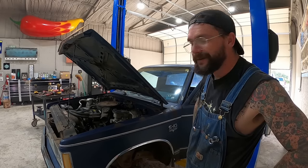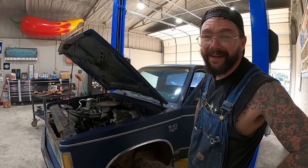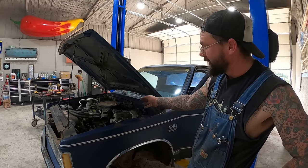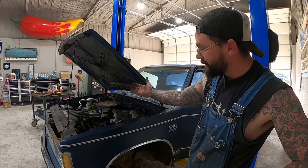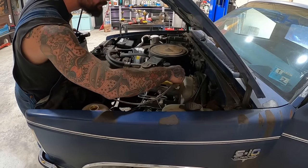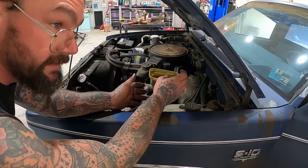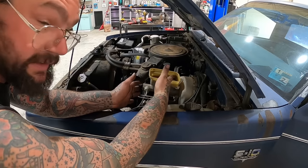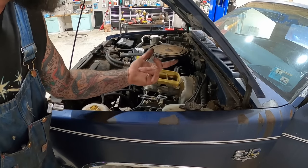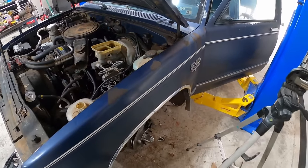The last little bit we need to do for our brakes is, I am gonna go ahead and put a new master cylinder on it, just for the sake of having one with good seals. We really don't know how long this one had been sitting, and I just don't want it to be a future problem for someone else. Now that you've cracked all your brake lines and the fluid has got all over your shop floor, it's a good time to go ahead and suck out the fluid out of the reservoir. As you can see, it is actually pretty dang dirty in there. So putting on a new line and giving this system a flushing definitely is not going to hurt nothing.